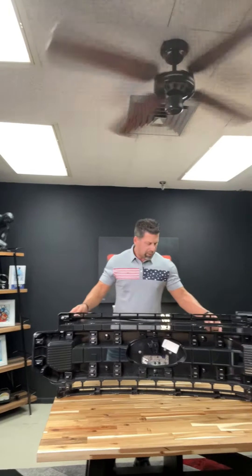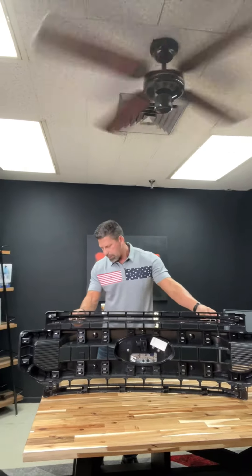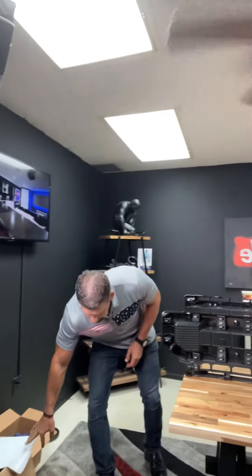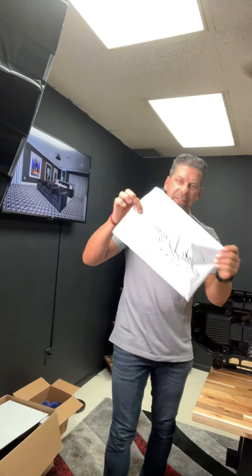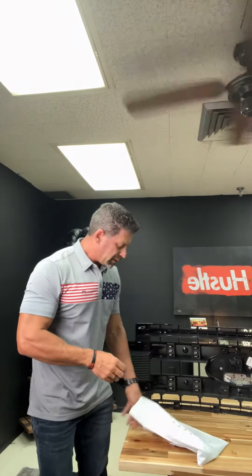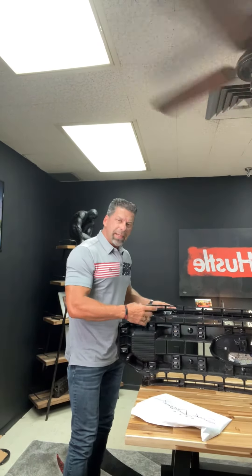I think you can see pretty good. All you do is pop the wire through, set the light in place, and then there is an installation kit — a little Sick Diesel installation kit. In that kit you'll have lock nuts, some butt connectors, and two backing plates per light. You take that backing plate, put it over the studs — it allows it to pinch the grill support bar — then put the lock nuts on it and you're done. This is a garage installation, it's super simple.